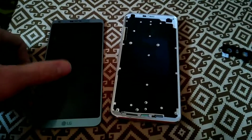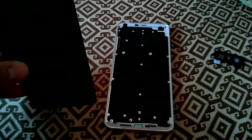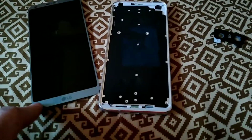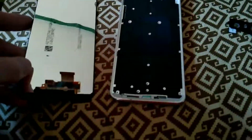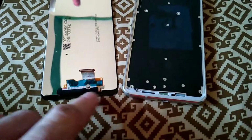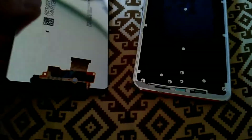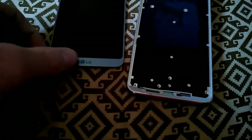The backlight would come on for a short time, and then it started to get extremely hot down in this area. I don't know if that was the bottom row of LEDs or if it was one of these chips on this ribbon cable right here. But either way, that got extremely hot.